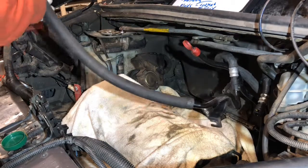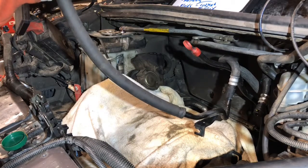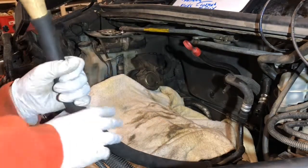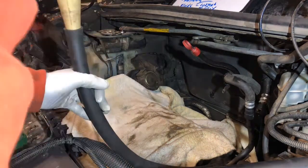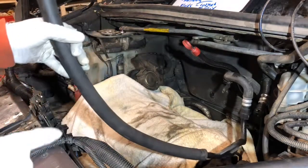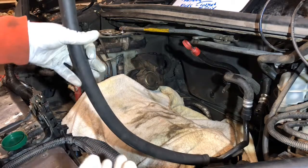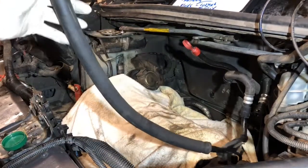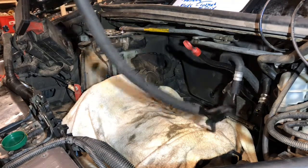This line right here is the lower line. On a heater core, it's flowing in from the top, draining down the core and then coming out the bottom tube. So when you back flush it, you want to be flushing up through the bottom tube. That way, all the debris that came in, you're literally helping it get out where it came from. So anyways, look that up though. I just confused myself, and some vehicles might be different. So look up your application.